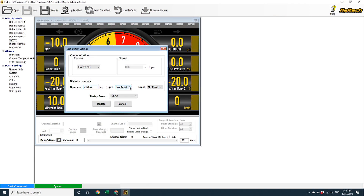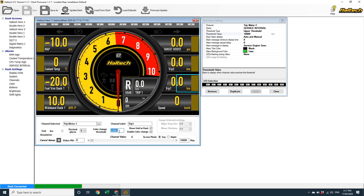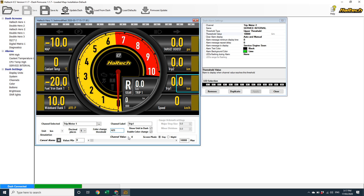I have to connect to the iC7 software, go into the systems menu, and click reset of trip two to clear this one. Now I'm going to remove trip meter two from my display, because I don't really want to see it here. The trip meter doesn't need to be on display for an alarm setting to be assigned to it. Instead, I will display trip one — the button-resettable trip meter — and because I know my fuel sender's a bit dodgy in this car, I'm actually going to set up the trip meter to go red when I get to 425 kilometres. I know from experience that gives me about 75 kilometres before I'm stuck on the motorway without any fuel.